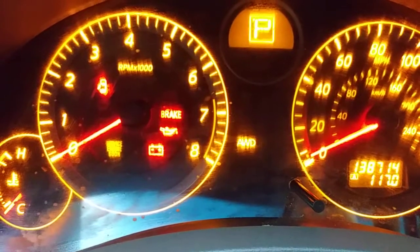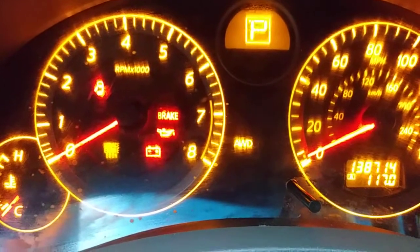So I pulled over and I checked my terminals because for some reason, on the negative side of the G35 on the terminals, they don't really make good connection. I don't know if I've just had the luck where I get a G35 where it doesn't make connection, but I tightened up the terminal and made sure it was getting good connection, and then for a couple of days those two lights didn't come on, so I thought I'd fixed the problem. But then the next day they came on again, and that's when the car started flickering.